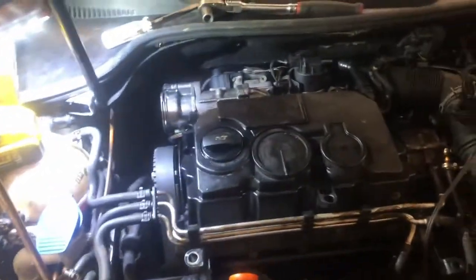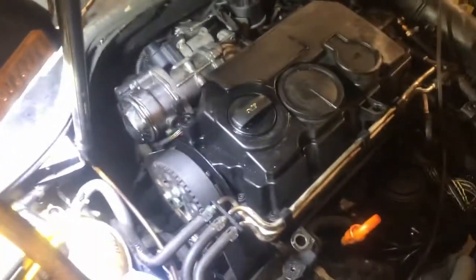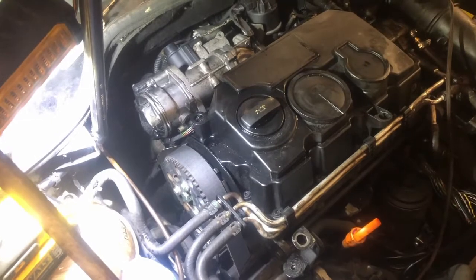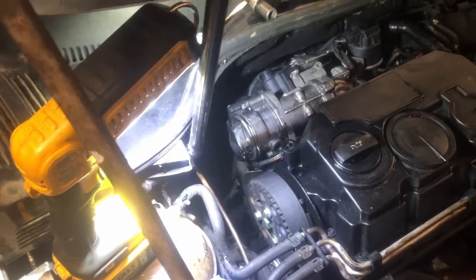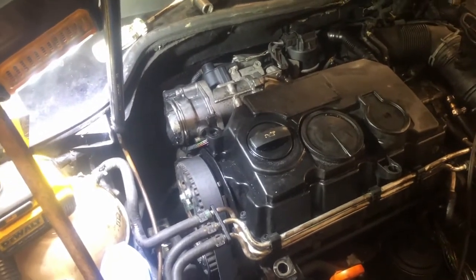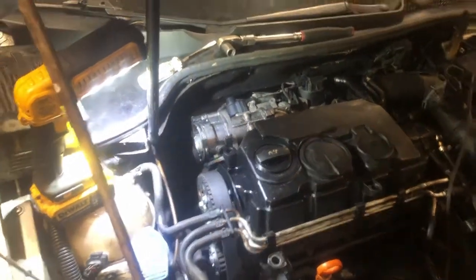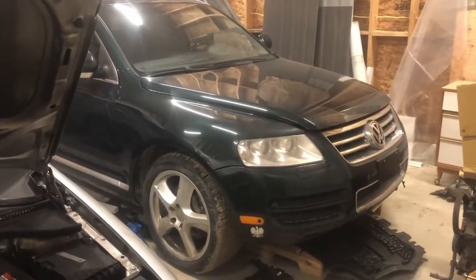The small adjustments can make a really big difference on fuel mileage and power, so that's definitely one downside of using the paint method. Before I did the belt I had checked it and it was at negative 1.5, so the new belt changed it 1.5 degrees. It depends on how the previous owner set it - whether the paint and pray method will work for you - and if not, the tools with VCDS is definitely the right thing to do. I hope this video helped anybody.